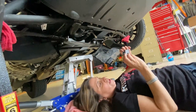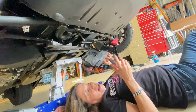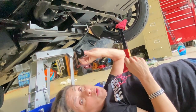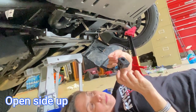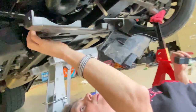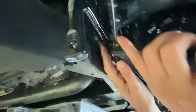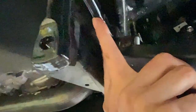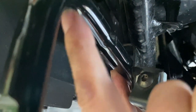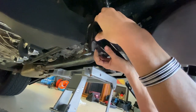Next we're going to put the bushings on. The bushings come together and it doesn't have a right and left either — either bushing will work on either side. The important thing to remember is the opening parts go towards the bike. You're going to reuse the same long bolt through the bushing. The bushing is going to go as close to the ends of the bar as possible, right between this wedge point and that part — at the very ends.